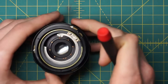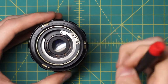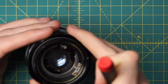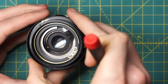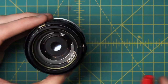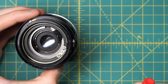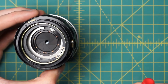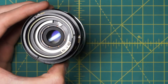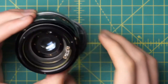We've now exposed the entire front of the diaphragm mechanism. With the diaphragm exposed on the front along with some mechanical couplings, because of the difficulty of getting into the diaphragm from the back section, if there's just a little bit of oil on it, it might be worth trying to clean it off in this current state. Getting access to the back of the diaphragm is much more difficult on this lens.